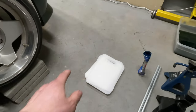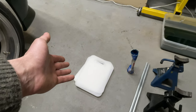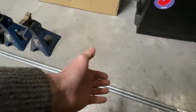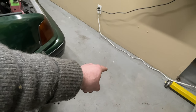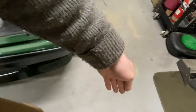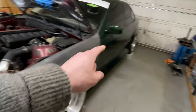Now you could do this with real turn plates — that would probably be better, obviously. We also have jack stands and some half-inch electrical conduit that I'll probably have to cut down to size. The idea is to put a jack stand at each corner of the car, just in front of it and off to the side a bit, and then run the conduit along in a straight line front and rear.